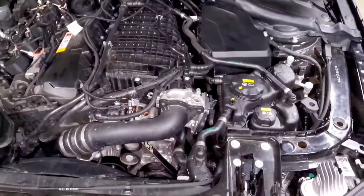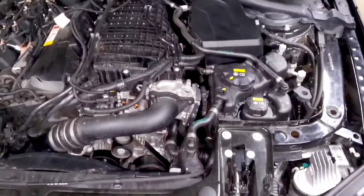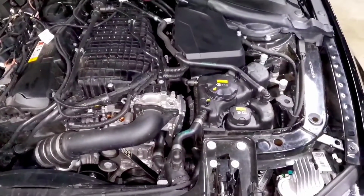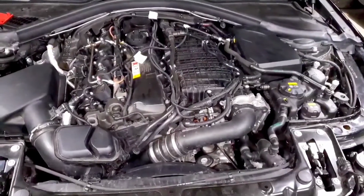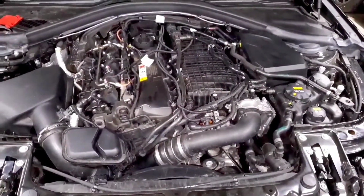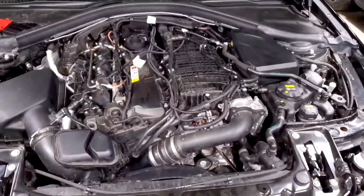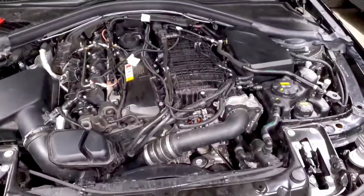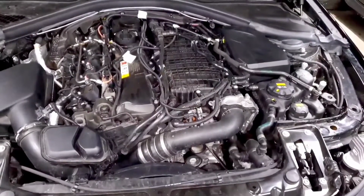And you can feel that when you go from comfort mode to sport mode, the sensitivity of the pedal is increased significantly. So a small touch of the pedal creates a lot of thrust because the throttle position opens a lot faster. Also, a lot of cars have an additional boost control built into the throttle position. So what you'll see sometimes is that the accelerator pedal position is at 100% because you're wide open throttle, but the throttle position changes. And that's going to vary depending on the situation that's going on with the car.